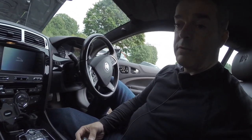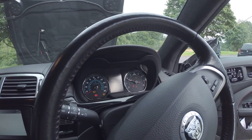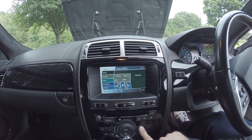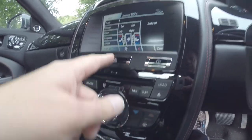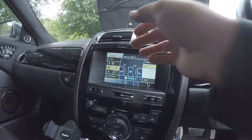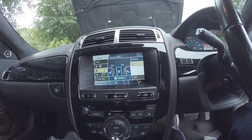You've got to make sure the car will switch on the AC compressor and that you've got no chance of it coming on and off — you want the compressor on, circulating the refrigerant all the time you're gassing as soon as it hits the minimum pressure level. So you've got to get the engine running. Set your temperature down to low — so it's on maximum cooling and the AC is on. The auto light is off because we've set it manually to low. As soon as we get the compressor running, we should go. Ambient temperature outside is 20 degrees, so we've set our trigger gun for that.